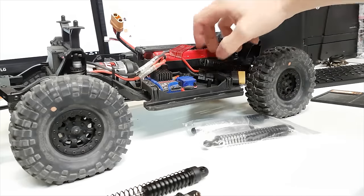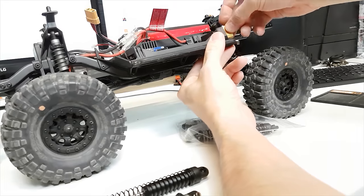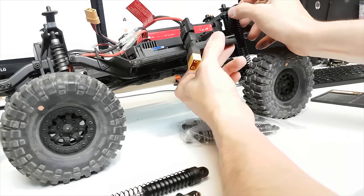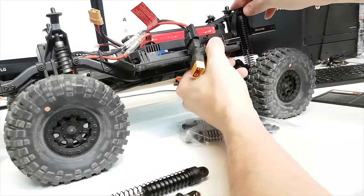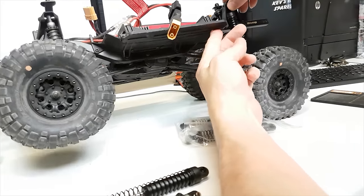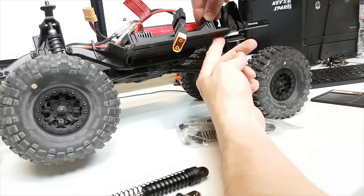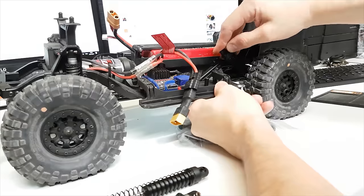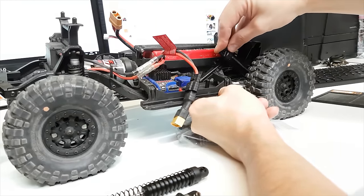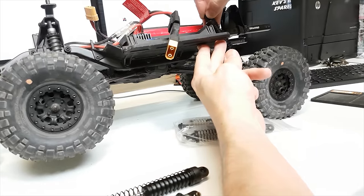Alright guys, I've put one on here so far. And I think it can't go any higher here for the body that I'm running. And obviously I can't run it in the standard shock mount because then it's not going to travel down at all. It's going to hit on the chassis as well when it articulates. So it's going to have to be mounted up here somewhere. Now I reckon if we close that, put that sort of, I don't know, somewhere there I think. And then as that moves up, nice bit of droop there as well.